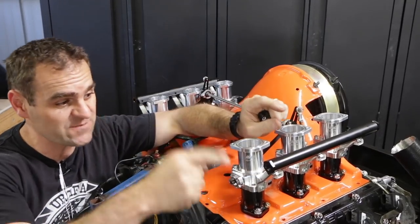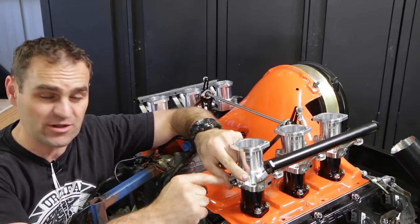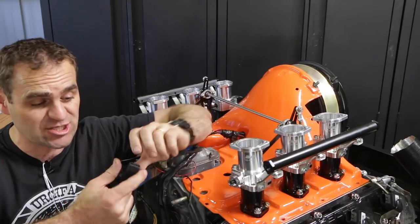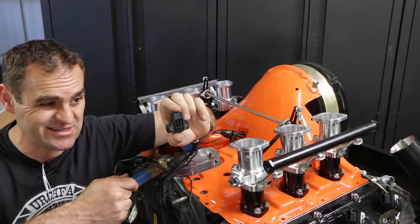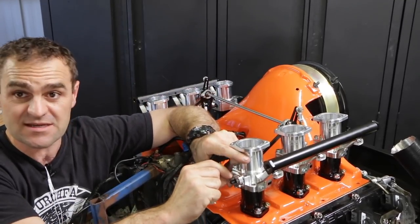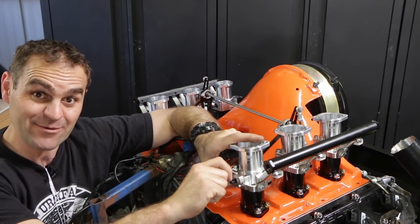Injectors and fuel rails are all mounted up and working. Now I'm just putting this fitting on the back of one of the throttle body lines. The RHD throttle body setup actually uses just a standard BMW E36 throttle position sensor — a nice, easy-to-get part. Now I just need to fit that up and we'll basically be done as far as I can go on this engine for the time being.